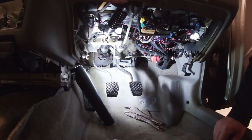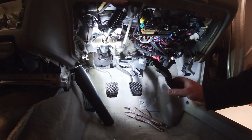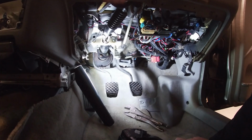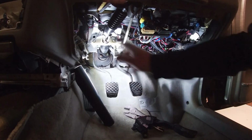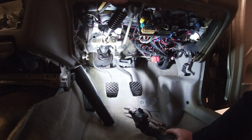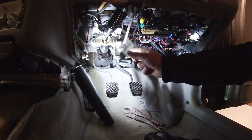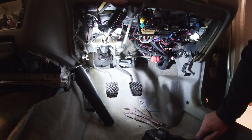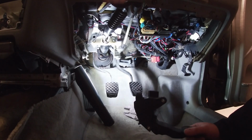We are deciding how we're going to put this throttle in place. The Leaf pedal. As we took out the old one, in retrospect, we could have very easily gone for the original pedal plus its cable all the way up the top, all still sprung, and put it on a potentiometer kind of device, Hall effect, basically innards and all that, up in the engine bay, actuated by the pedal and the cable. I may do that in the future because it would make this a bit easier, but we're here now, so let's come up with a solution. My eagerness to rip out the pedal got the better of me.